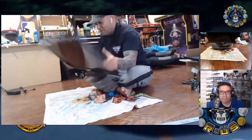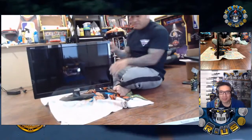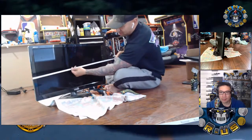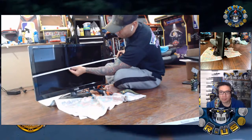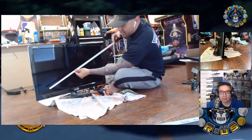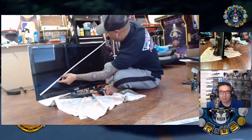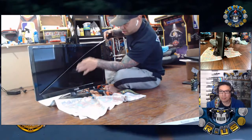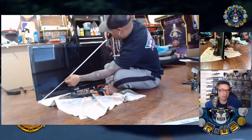First, I'm going to figure it out. This is a 27 inch. So for the correct measurement, remember guys, you don't measure this way. A lot of people measure from the border to the border, and that's almost 26 inch. The correct way is from the edge of the monitor screen only. It needs to be the screen, okay? Exactly 27 inch. So you have to measure diagonally, from left to top, screen only. Do not measure from the border because it ends up being 30 inch.